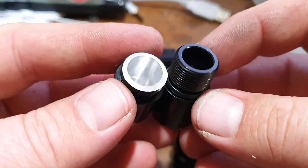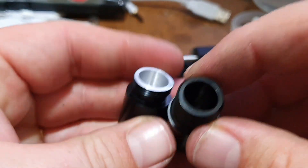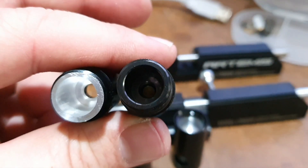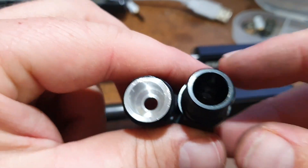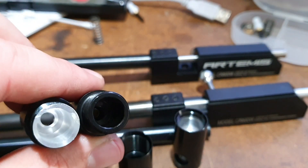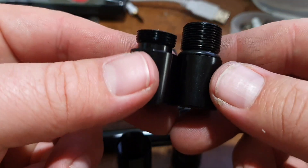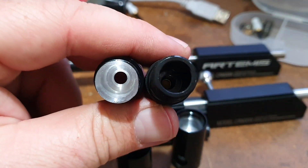There's not a lot of pressure on the threads. Looking down inside, I've brought it out to a larger internal diameter and also deeper — it's around five millimeters deeper, slightly more. That helps in two ways: it gives you a little bit of extra valve volume, but it also lengthens the seat for the valve spring to sit against, so it softens the valve spring a little bit.